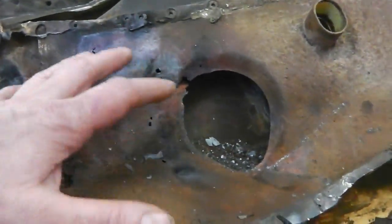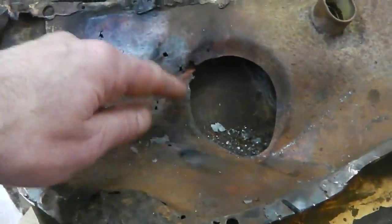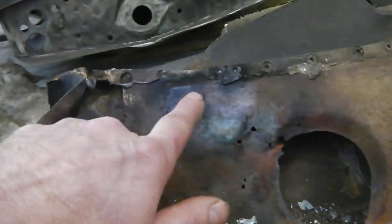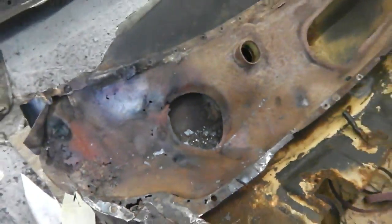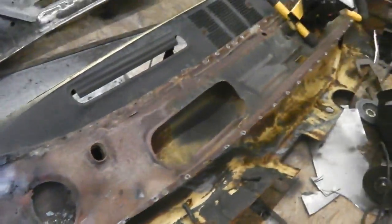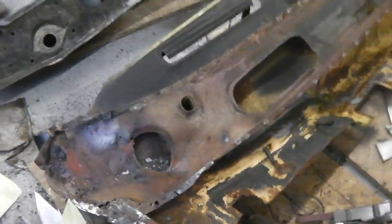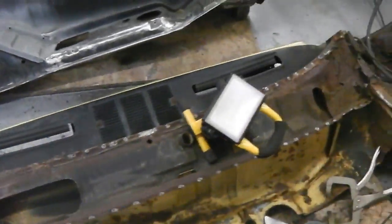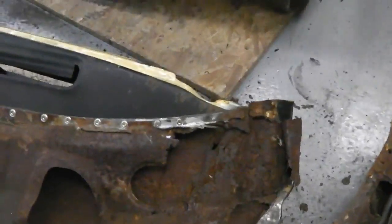And we're going to use some hot flame, oxy flame, to hammer metal into shape so we can get little imprints like that and shapes around here. So I'm going to have a go at making it because we can't get that panel. It's hidden under the scuttle, so you could get away with it not being an exact match, but I want to try and get it the best I can. This side's going to be even harder because there's less material to work with.